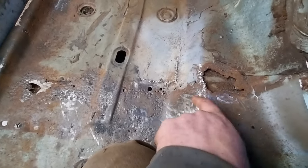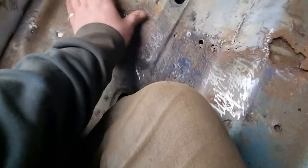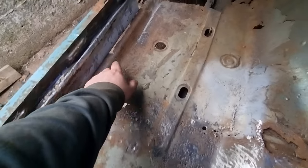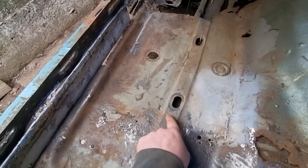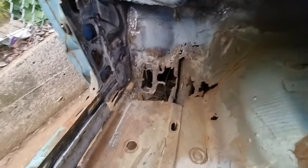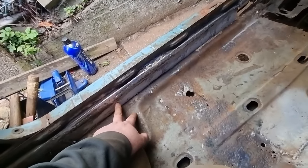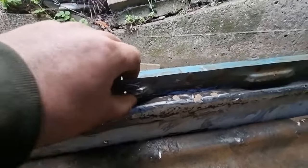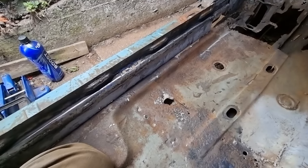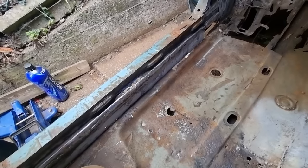All this is good — this is a little bit pitted but it's strong. So once I've made that section of the floor and welded it to the inner lip of what I've made at the bottom, I will then take the chassis rail off. At least the floor will be nice and strong — take the chassis rail off, put the new one in, and then repair all that up there. Looks like the passenger side is going to be done before the driver's side. And as I've managed to make my own and it's no different to the original, I've decided I'm going to save the lip on the driver's side and make my own inner sill there as well. Then all I've got to order is outer sills and floor pan.